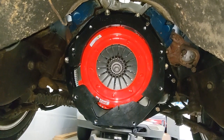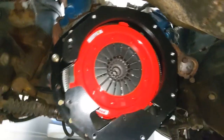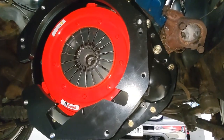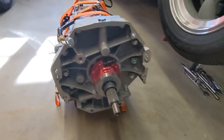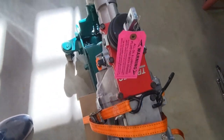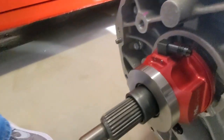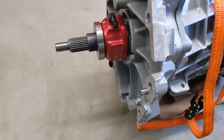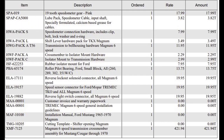All right, what else? Here's some bonus footage that shows my McLeod clutch installed, followed by some shots of the McLeod hydraulic throw-out bearing. I think I forgot to mention that I did use Ron Morris motor mounts. Those were drop mounts that dropped the engine a half inch, gave me a little bit more clearance in the tunnel. But I think when I swap the engine, I'm going to pull the transmission back out as well, indent the transmission tunnel brace to get a little bit more clearance and allow me to move the transmission up a smidge to get a better driveline angle. I think I'm also going to link a video in the description below that talks about driveline angle and vibration. I found that pretty useful.